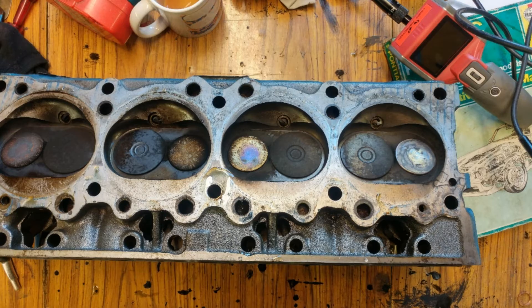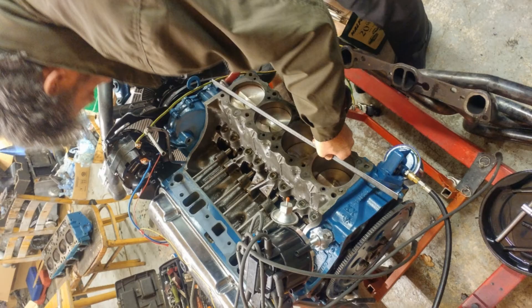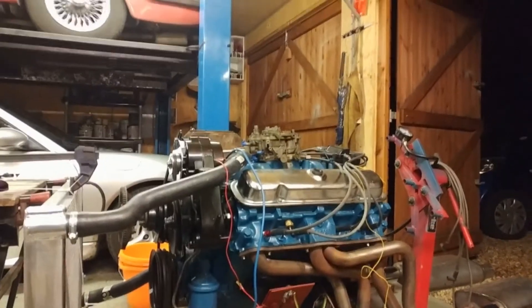You can see here — not good. It turns out I didn't have the heads on quite properly, one of the heads anyway. You can see there's a little bit of leakage there. There were these little dowels that stick up and I hadn't pushed the dowel far enough down. My friend pulled me over on that and came up with the conclusion that it was the dowels. There's the engine on the test bed where you have to break in the engine.